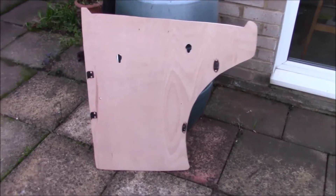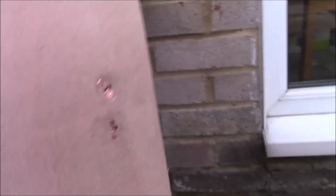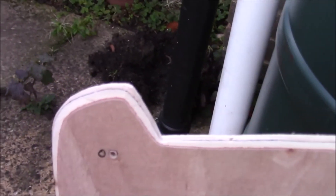This is one of the door cards that we already cut out, so you can see these are the little brackets that hold it onto the sides, and there are the holes after they've been trimmed. Those are the keyhole types, so you drop it down when that's done. On the front face of it, you've got the back of the rivets, and they go nice and flat — the little legs actually hammer into the plywood, so they don't show up through your fabric layers. The top edge is just sanded with a slight bevel, and that helps the fabric ease over. This is actually very useful on the new plywood, because it's ever so slightly thicker than the original.